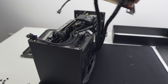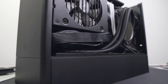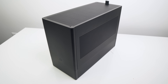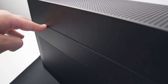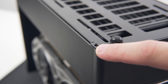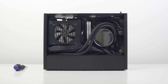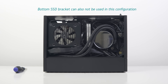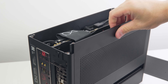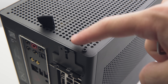Starting with the 240mm AIO in the bottom mounted position — a lot of you wanted me to check this out because it looks a lot more balanced and pleasing than the top mounted position. It is completely doable, although I still experienced slight fitment issues as in my initial review, as the tolerances are not perfect. Specifically, the sides of the top hats still bow inwards if you tighten them up, and fitting the bottom panel onto the top hats was a bit tough and required several attempts. In the end, it required me to loosen up the top hats to get a snug fit.